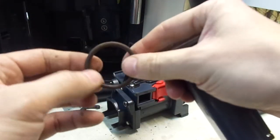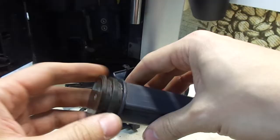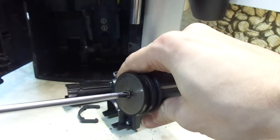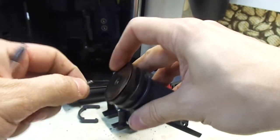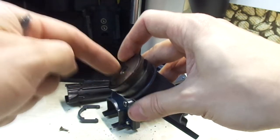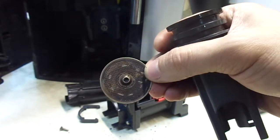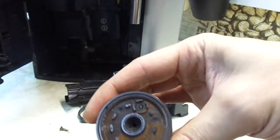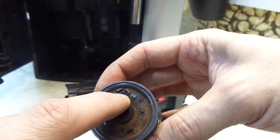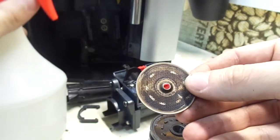You can see this O-ring has started to roll and needs to be replaced. The top O-ring is in better condition but still not good, so we remove both O-rings. We then remove the metal screen using a Phillips screwdriver — don't lose this stainless steel screw. You can see coffee residue here. We will also remove this valve, which is what creates the foam in your coffee.